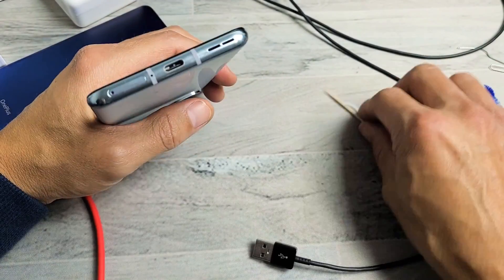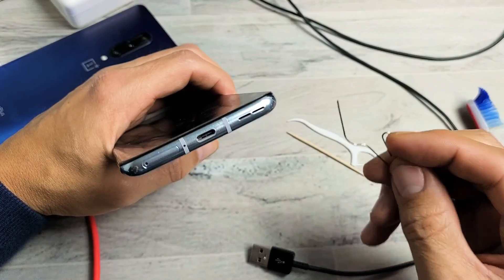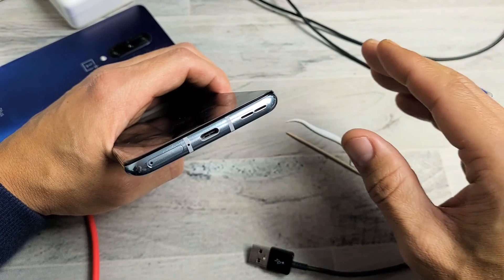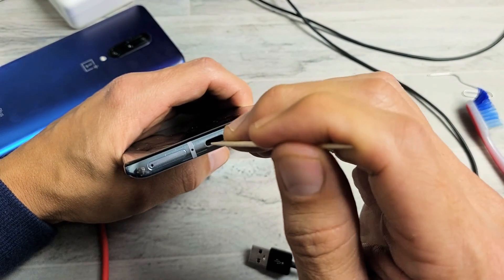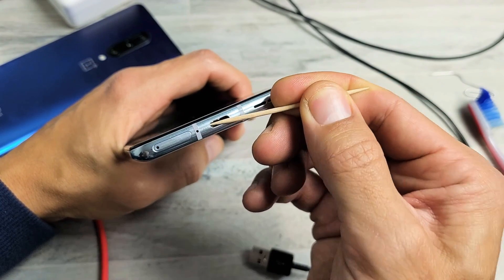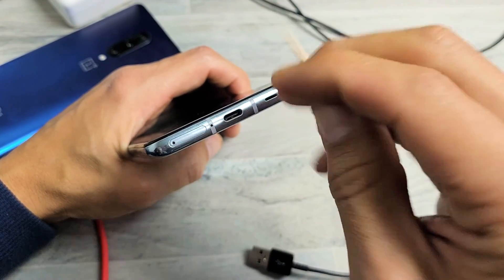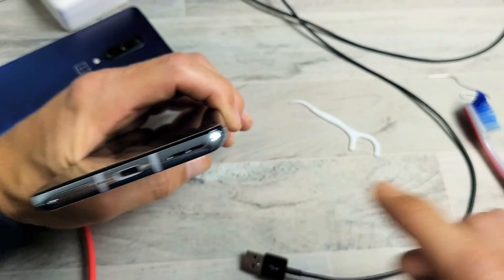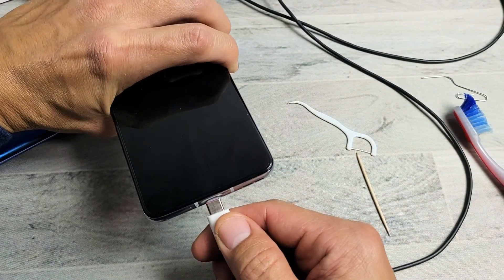If you're still down, next thing I want you to do is grab a wooden toothpick or a plastic toothpick. You shouldn't use metal — I wouldn't advise that, though I am guilty of doing it before and it actually fixed it. I'm not responsible for anything that happens to your phone. Use a wooden or plastic toothpick and try to get in there as much as possible and kind of just lift up. A lot of times, surprisingly, you'll pull out some kind of lint ball — a lint buildup — and you can just slip it out. Be gentle, and you might want to get a little flashlight to look in there. Give it a little blow and keep doing this, then plug it in and see if you are finally charging.